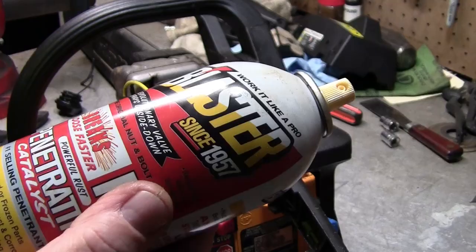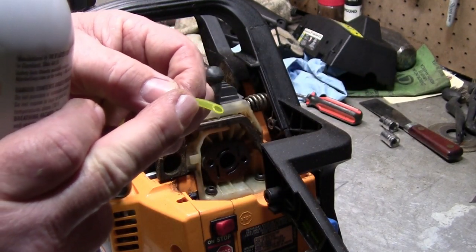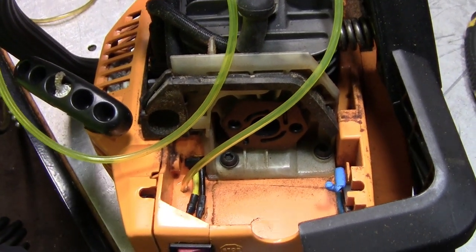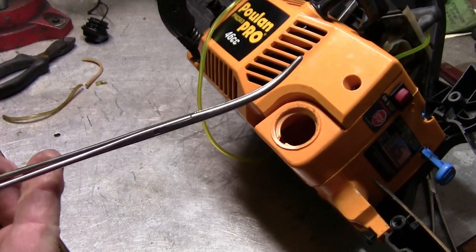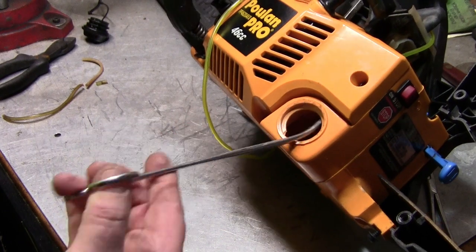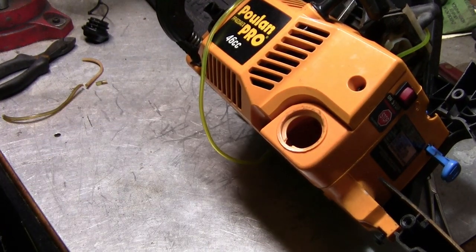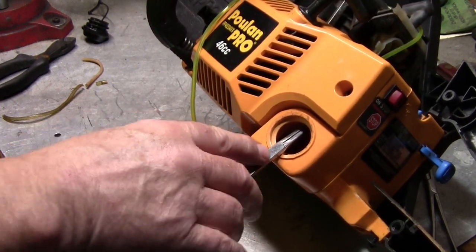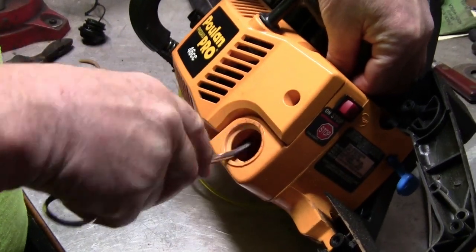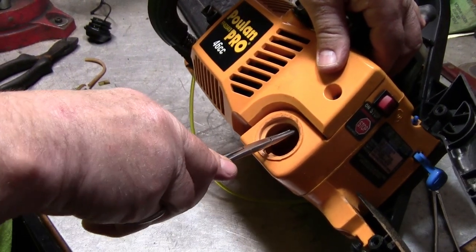Take this point right here and shove it down into the hole on the top of the gas tank. What I usually do is take PB Blaster, WD-40, or some kind of oil to lubricate the fuel line — that way it'll slide down into the top of the fuel tank. Once you get it fed down in there a little ways, it'll be sticking through the other side and you should be able to take a pair of hemostats, go up in here, find it, and grab it and pull it out. I can stick my finger up in here and feel it sticking out. Okay, I've got my hemostats on it — I'm going to go ahead and pull while pushing it through the top.